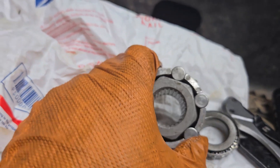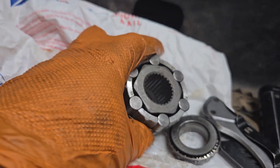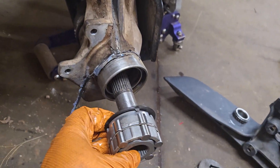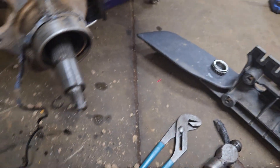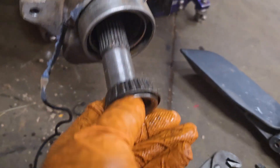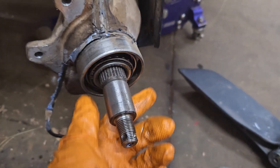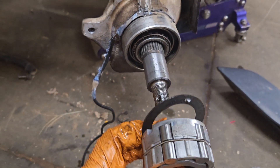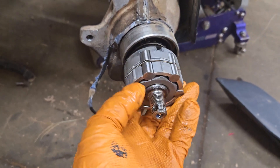The arm — hexagon shaped, almost looks like a nut with splines — goes in the center. So all of this goes onto the shaft first. There's actually a bearing before all of that, so this bearing here will go first. Goes up in there. I'm just trying to show you really quickly how the assembly of this is, just in case you pulled it loose. Then this plate goes on next, and then this cam goes on next.